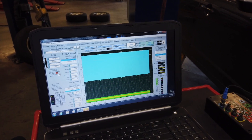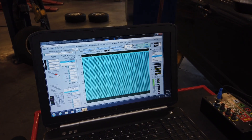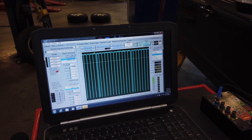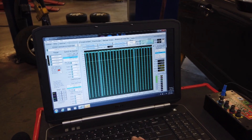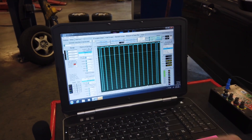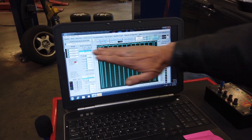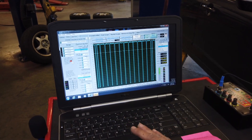If we open up our waveform a bit we'll be able to see a much healthier, cleaner signal, and this P0335 should essentially be solved. Pulling up one cycle of the engine — this is the number one identifier where it repeats with these double strikes on the waveform — you'll notice compared to the first video how much smoother and more controlled the voltage is, even at the bottom.